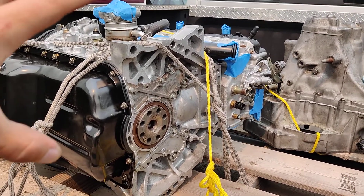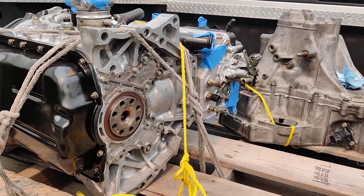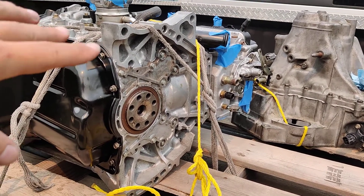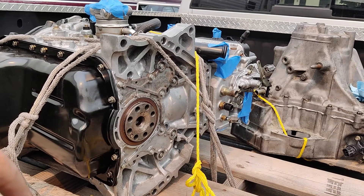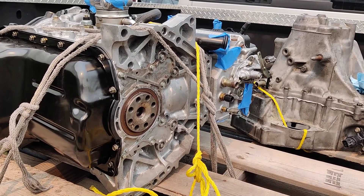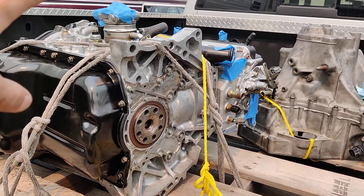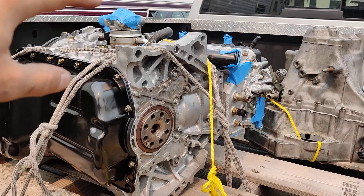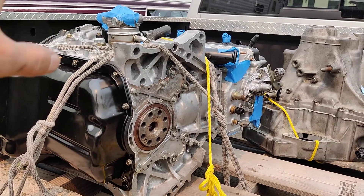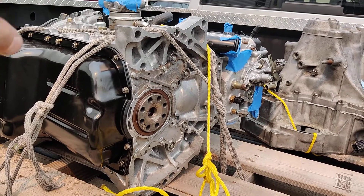This motor — I'm assuming it's going to land about 9,000 RPM where it starts to taper off. It is 13-to-one compression with custom Wiseco pistons. The rods are Carrillo Pro Series. It's all touched up, lightened, and balanced. All the clearancing was done by Simon at Namus Industries.